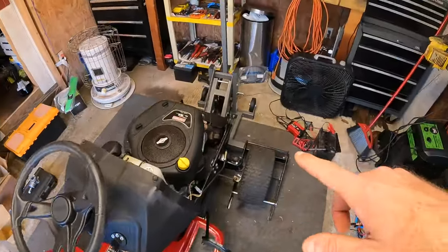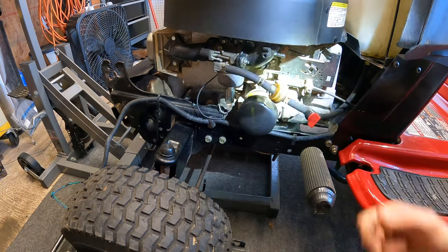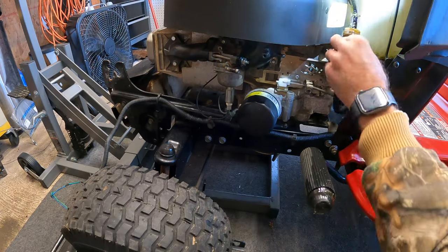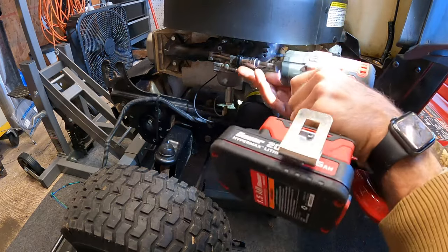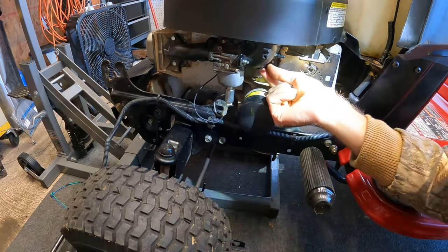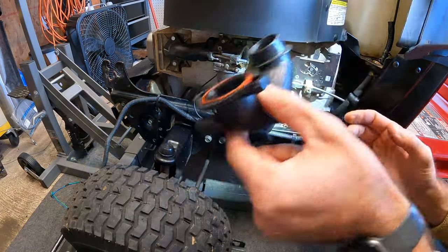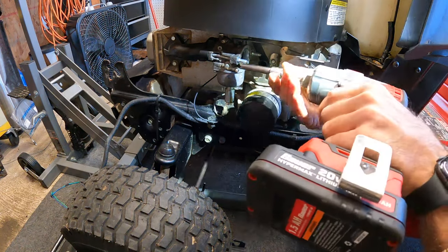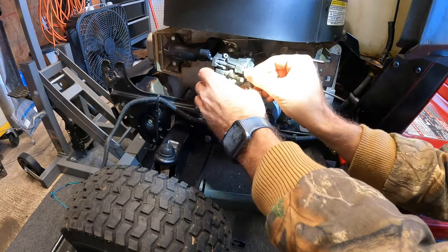It's surging even at the lower end now, and on the high side. Let me get you set up on the tripod and let's get this thing swapped out. First thing we're going to do is turn the fuel off. Normally you just need to get a pair of pliers on there, just put this up out of the way. Now we will disconnect our anti-backfire solenoid, then we have two 7/16ths bolts. There is a breather hose on the back side — you can just pull that right off. Now this is what we loosened up that top for earlier so that we can slide that intake tube right out. Now we have these two studs which need a deep well 5/16ths.